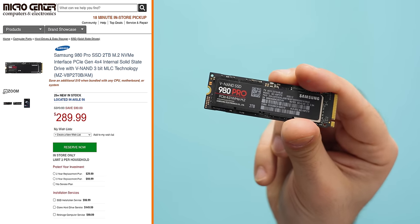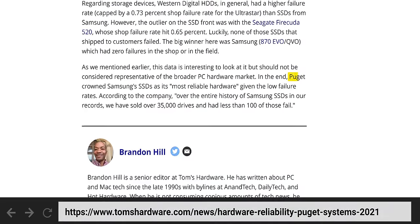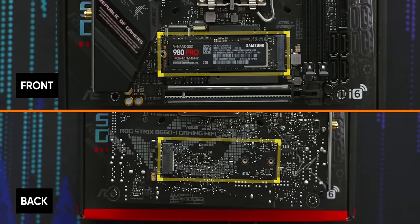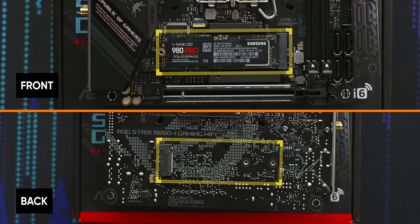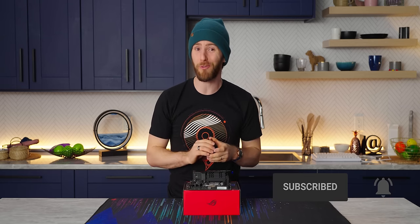The next step is to install our SSD, a Samsung 980 Pro. It is pricey, but Samsung regularly performs very well in Puget's reliability reports, and it's a really fast drive that can truly take advantage of PCIe Gen 4. Capacity, as always, is a personal choice, but since we only have two M.2 slots, we decided on a two terabyte model so you won't need to upgrade right away — unless, of course, you're a data hoarder, in which case make sure to get subscribed so you don't miss our upcoming video about who's the biggest data hoarder at LMG and what solutions everybody uses.